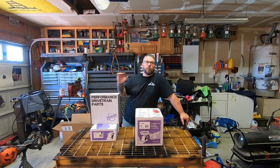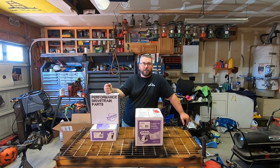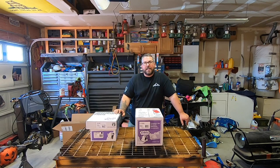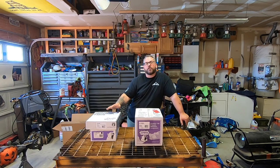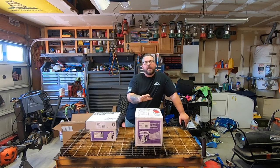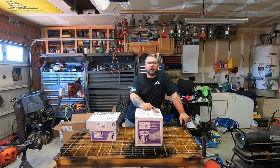It came in a kit that included the rear end, which is a Chrysler 8 1/4. It was on sale so I went ahead and picked it up. I know a lot of people feel very strongly about the gear sets they get, but Yukon has never steered me wrong. Something separate I did have to order was a new carrier. The instructions said that if you had 3.55 gears, which is pretty standard, you will need to replace your carrier with a new one. This new carrier covers 3.73s and up, and I have 3.55s, so the gears just will not fit on the old carrier.